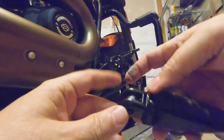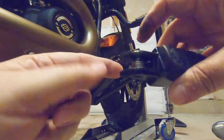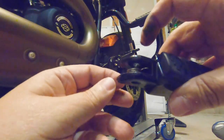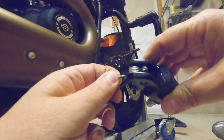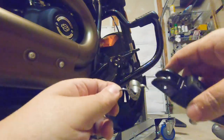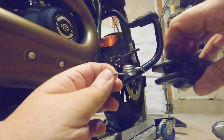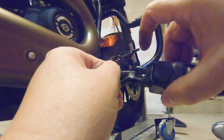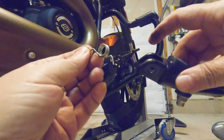So that's the old peg. The spring actually has one big difference: the end that came out of the frame is longer than the other end. You've got a hole in the foot peg — just like you will in the mini boards — where the short end goes into, and the long end goes back into the frame. It's really simple as long as you orient the long end towards the bike, because you can't put it in backwards — the hole is only on one side.